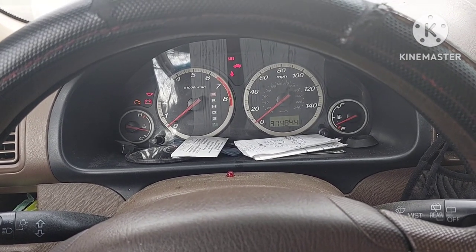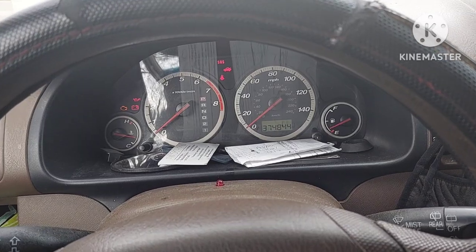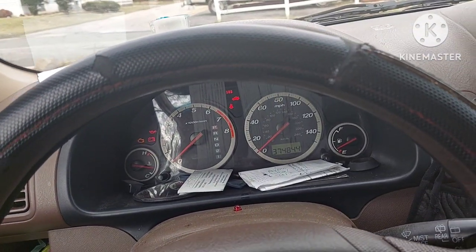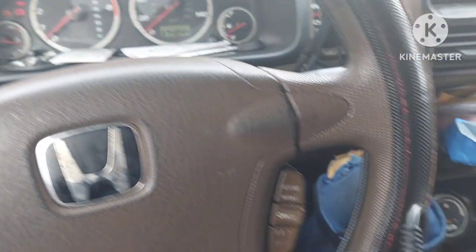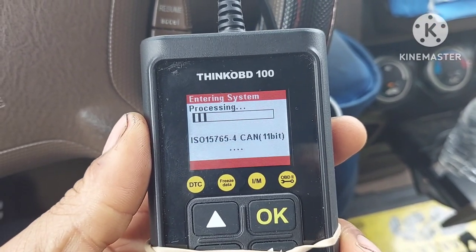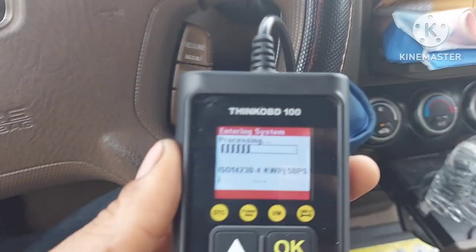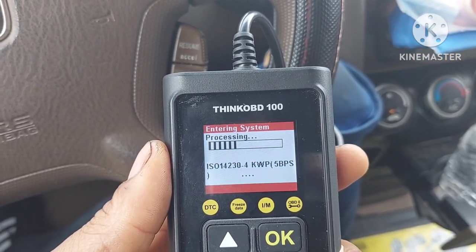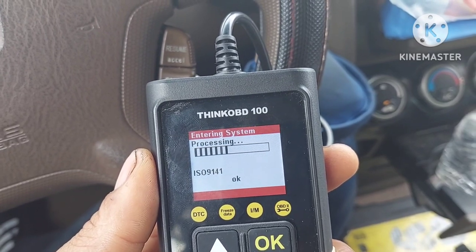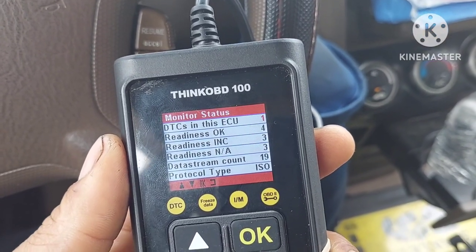I know it's an old car so I don't expect great things. I've been trying to keep it together mechanically, but granted I've been hauling firewood in it — really abusing it. Now, I've been losing antifreeze slowly. The temperature gauge doesn't go up, but I haven't found antifreeze on my oil dipstick, and I haven't seen antifreeze come out the exhaust that I can tell. But I do smell antifreeze every now and then, like it's getting burnt somewhere, so I'm assuming it's a head gasket problem.